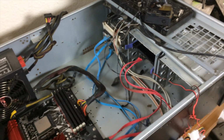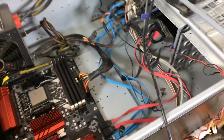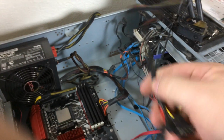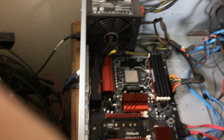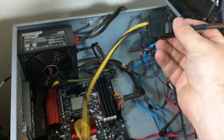Up next, SATA power. Okay, so we've got SATA power in. I was able to remove one of these SATA daisy chainers, well good, now that it's coiled around everything. So that's good. I'm using just enough ports in the machine to make this work. I was also able to remove, so far, a Molex modular power lead off of the power supply. I've not seen any need for it because I'm already using one, which has this curious Molex to 6-pin converter hanging off of it as well.